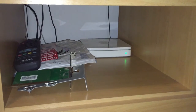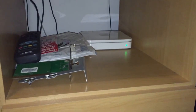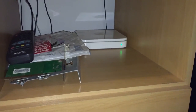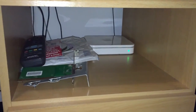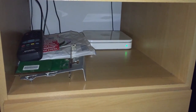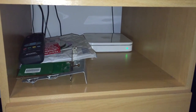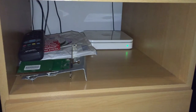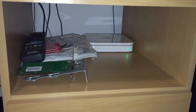This house only has Wi-Fi connections, and Wi-Fi on a server is not really a good idea because the server really wants gigabit ethernet in order to access files. Wireless N works okay-ish, but it's really slow in network transfer - like 4 to 10 megabytes per second. And the drives can do much more than that.